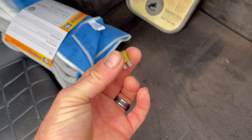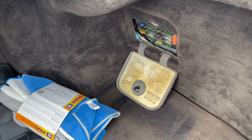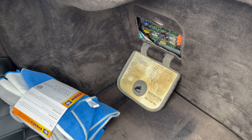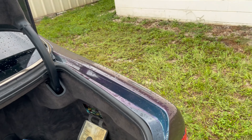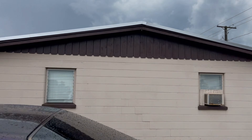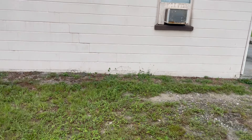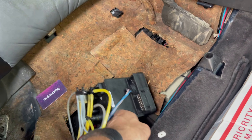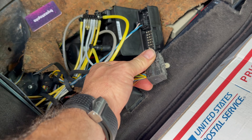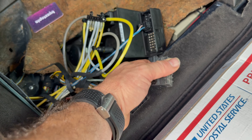It's the next day and I've got some bad news. Every time I try to use the lock button in the center, we blow fuse number 11, which is for our PSE pump. A lot of times that blows when the pump is overworking due to a leak somewhere, which can cause a short and kill the pump. But in this case we just hooked it up and it blew the fuse immediately when we hit the button, so I think we have a short in one of the wires. It just started to rain and a storm is coming, so I need to get that fuse changed and the windows rolled up — that fuse also controls the windows closing when you shut the doors.